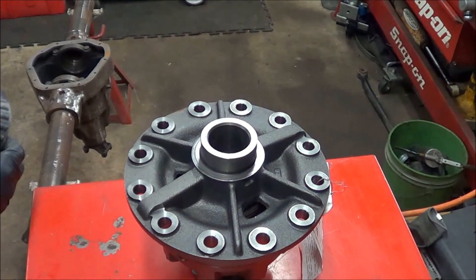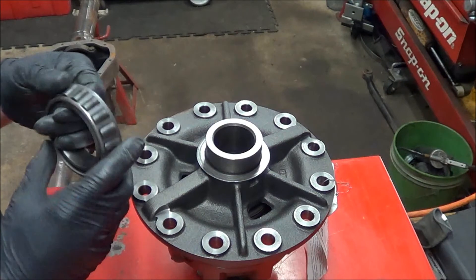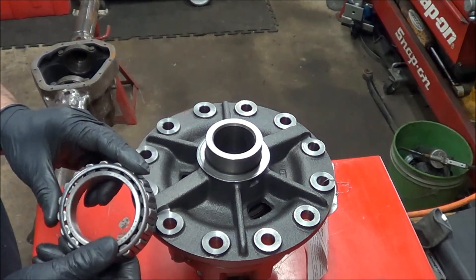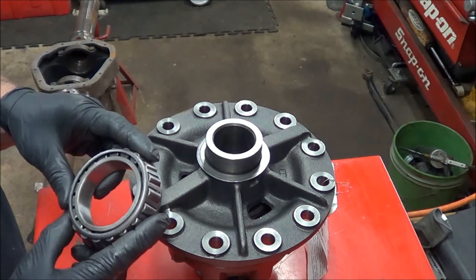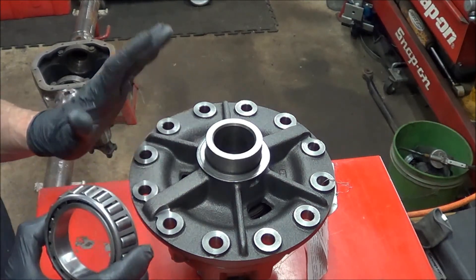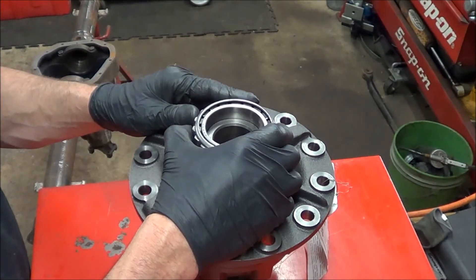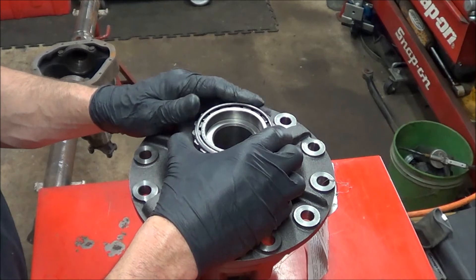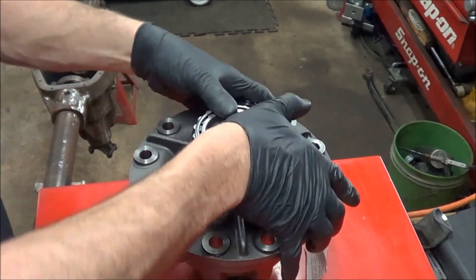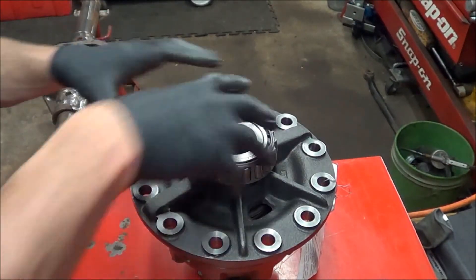After about five or so minutes, we're done. One thing worth mentioning: this bearing will get hot when you do this, and it's probably a good idea to get it to the same temperature as your diff before you try placing it on, because if it's warm it'll be a little expanded and it might not come off so easy. So there we go.